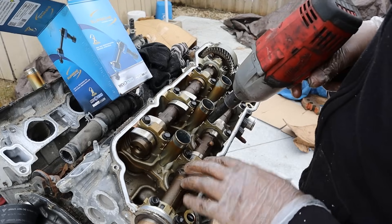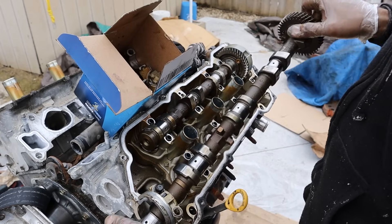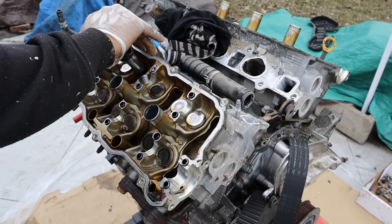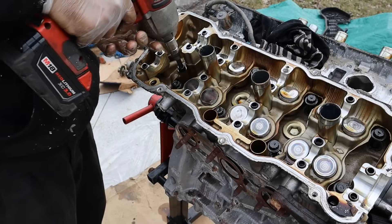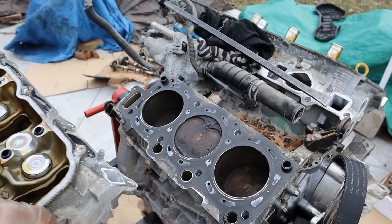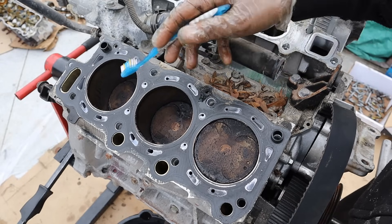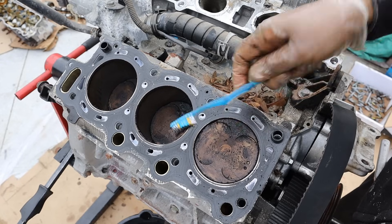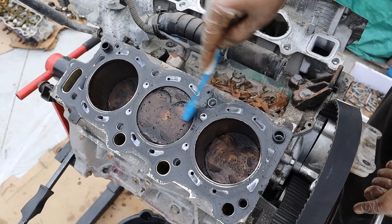Now I'm removing the camshaft. I'll go ahead and remove both the exhaust and intake camshafts. The head bolts take a 12mm 12-point socket, and there's also a secret head bolt on this side that's an 8mm hex. I'm going to go ahead and remove the head. Taking a look at this engine, you can see that although the valve cover looks absolutely brand new, inside the pistons are not exactly the same — there's some crust built up on top of the piston, though it's not terrible. The top of the valve cover is definitely not an indication of how the pistons are doing.